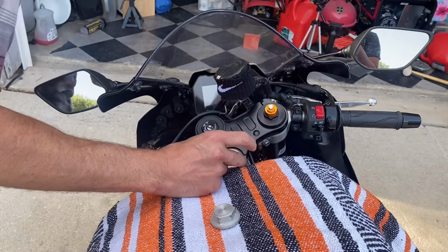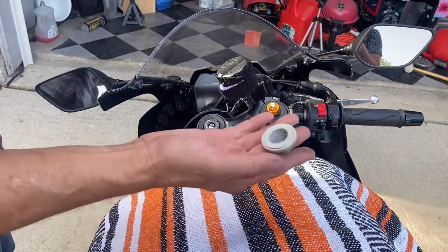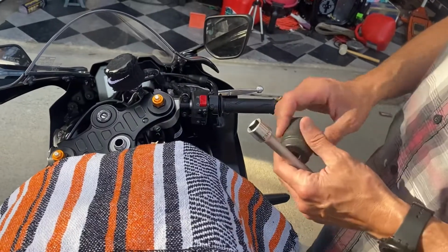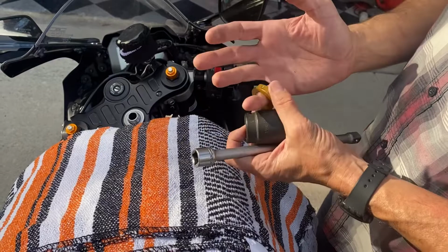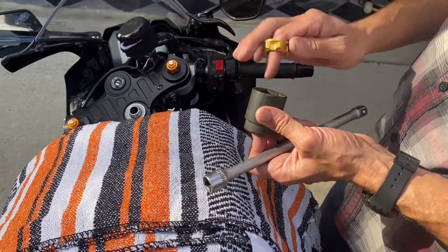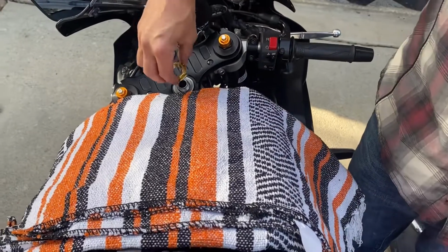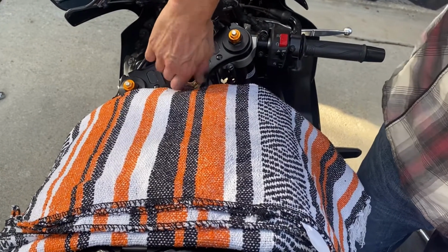Okay, now there's a washer there. There's a spacer there. We're gonna keep all that there. The only thing we're gonna do is replace this nut with the other nut. Okay, so we have the proper socket here. This particular socket is a 1 3/16. It ends up fitting it exactly perfect. Okay, it's probably about a 28mm if you're gonna go for millimeters. All right, so before we start putting a wrench on there, let's see if it'll hand thread. And it does. Perfect.